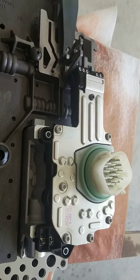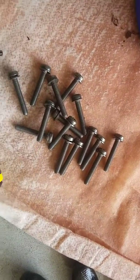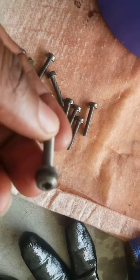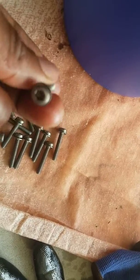I'm gonna slap it back in the truck. Like I said, it's not hard — 15 screws come out. Just so you know, these have to be torqued in inch pounds, not foot pounds. Inch pounds — make sure you remember that.